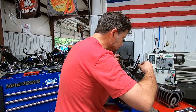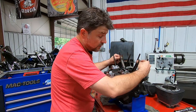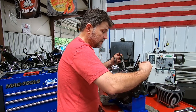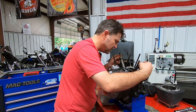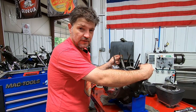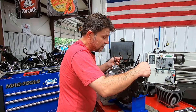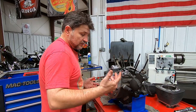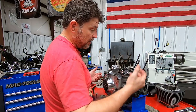Taking a peek inside, we do have a good bit of oil on the crank, and there's quite a tight spot in this crank right here. It appears we had a sumping issue on this one as well. I can't say definitively it's because of cylinder and piston clearance or ring seal. I'm going to predict we're going to have an issue with this crank, because even at this point the crank begins to lock up on me. This could be one where a crooked crank is affecting the oil pump — then you get some backup, aeration, and cavitation of the pump.